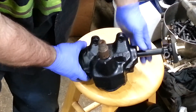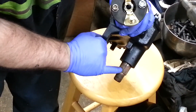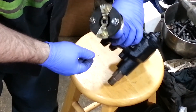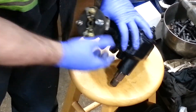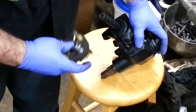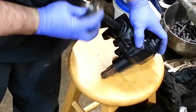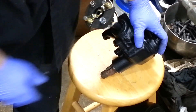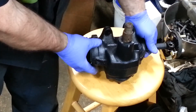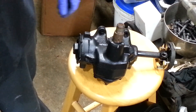When you have your gearbox centered up and it's going to be mounted on the car in this position, this line will be forward toward you in the car, so I marked that with a long line. You can use that as a basis for putting the Pitman arm on. Then you can take the coupler here, put it in the proper position — it gets splined — and on the shaft you've got a small bolt and a large bolt, plus a tightening nut. That's how you center up the shaft when exchanging a new gearbox, whether it's power steering or not — that's usually the method I go with.